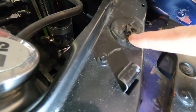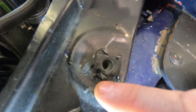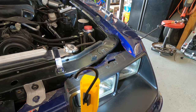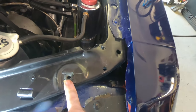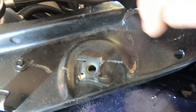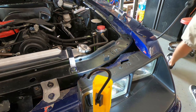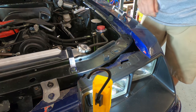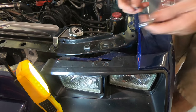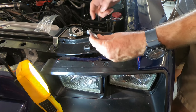First thing we need to do is get this bump stop out. These little tabs fold over and hold the cage nut in place. We're going to cut right there on the tabs — there's one. As soon as I cut that little tab, the top plate just flew off. The cage nut is set in there just like this, so you can pry under it and pop it off since the hole behind it is just a rectangle. I'll cut right there to loosen it and pop it out. Just like that — now we've got a triangular area for the pin installation.